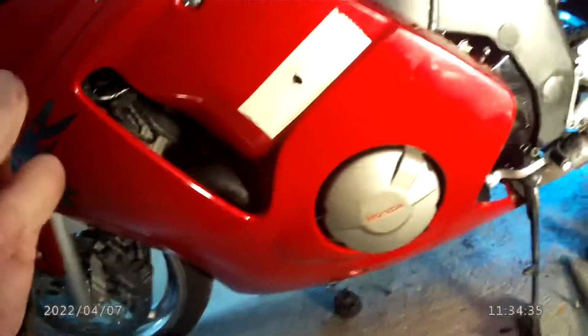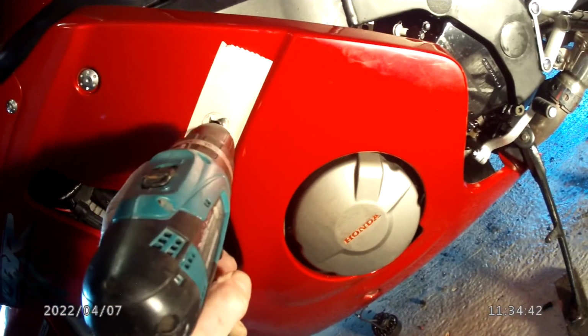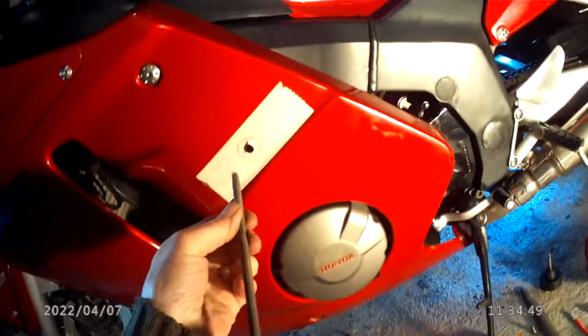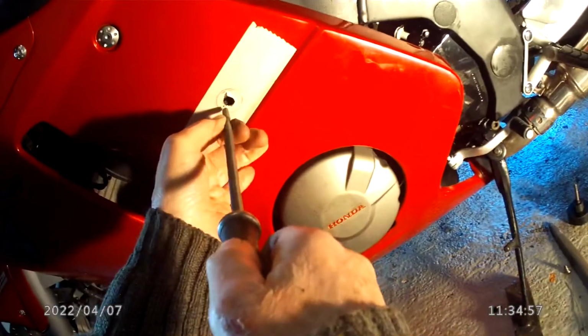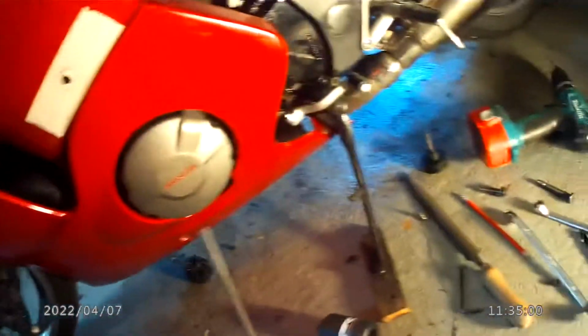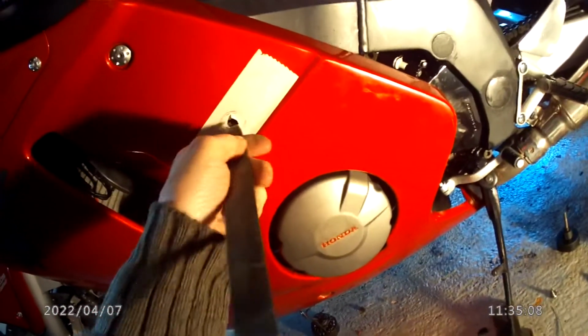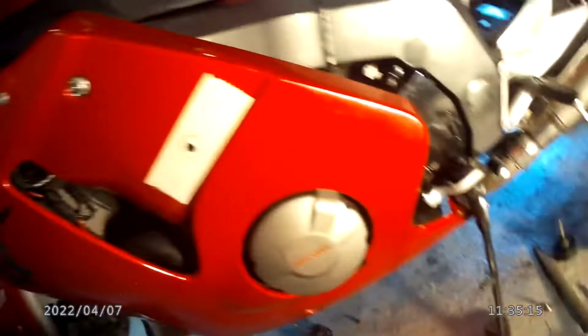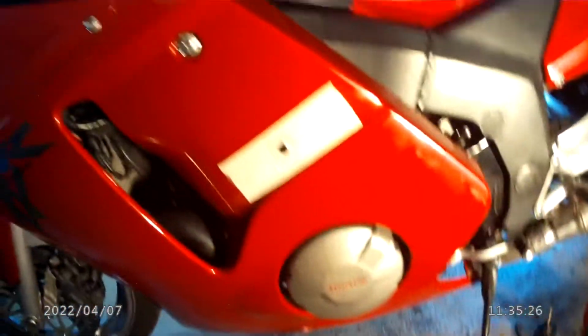All you have to do, well, what I do is I just put a small drill through all the way around, bonk bonk, all the way around inside the line. Then open, I mean this stuff files easily, just pop that in there and then you can file, open up the holes, and then use this to just get close to the pencil line. And then when you've got a decent hole, get a half round file and just get the profile accurate so that it's an absolute perfect circle. And then you'll find that that will just go through and it will be in a perfect position. And when you've put the spacers and all the rest of it in, the job is done.